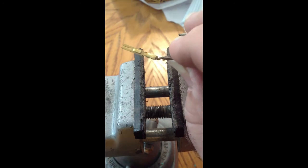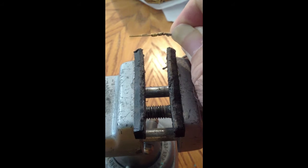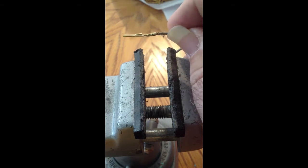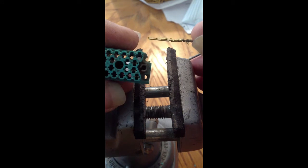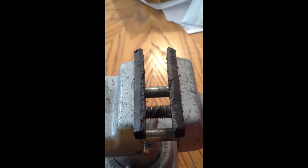And that's what the pins look like — and again, it's the same pin on both sides. You see the only thing that holds them in is that protruding little tab in the center there. You might ask why I go through this trouble, because these connectors are made of that turquoise colored plastic which really breaks up pretty easily. But I'm not doing hundreds of pounds — I'm just a hobbyist. You guys that are doing that kind of stuff and maybe have presses or big vises, more power to you.